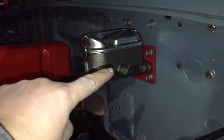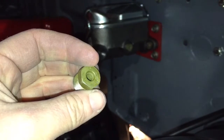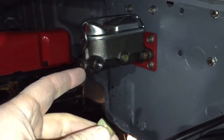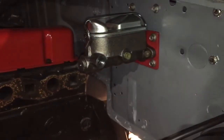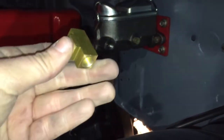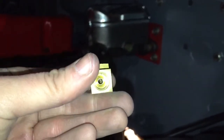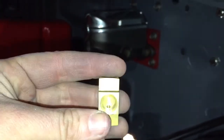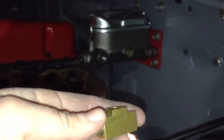Not a whole lot of room under here, and it's still on jack stands. The wheels are on, but this always makes me nervous getting under here. The green fitting coming out of the back portion of the master cylinder is the same — it's a 9/16 fitting — so either I need an adapter to go down to 3/16, or I have to flare these on, which I have them and know how to do. The flare would fit in on that, but it doesn't fit on there, so I'm going to have to figure something out.